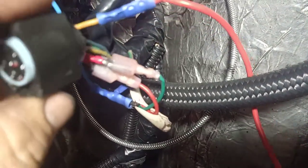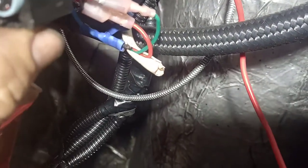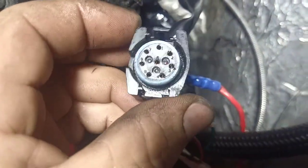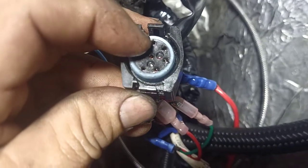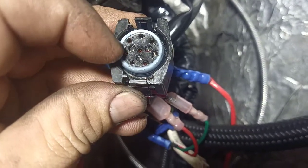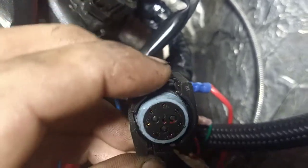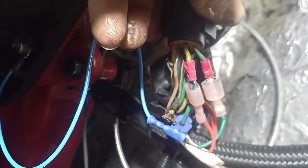I ran a wire out to a power source. I turned my vehicle on — I have an Air Dog, so I used that as my power source. I'm holding the pin this way. In the diagram it shows the pin differently, but I hold it this way because that's pin one, that's seven, and that's six — overdrive or lockup, or vice versa. I don't remember right now.